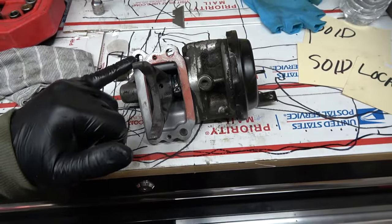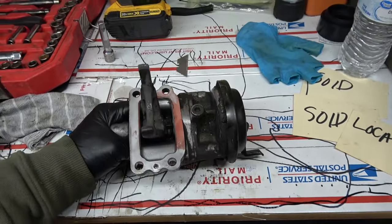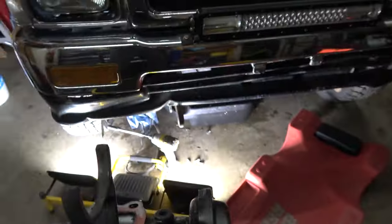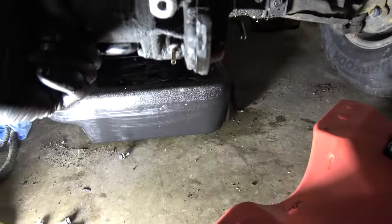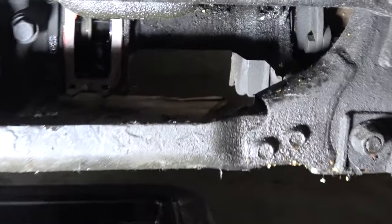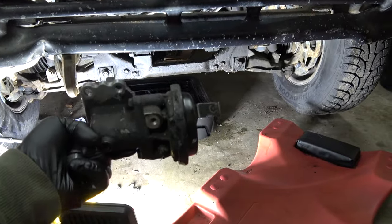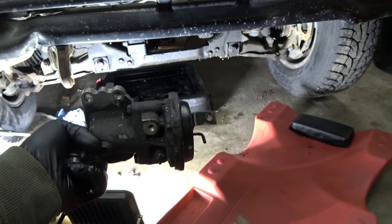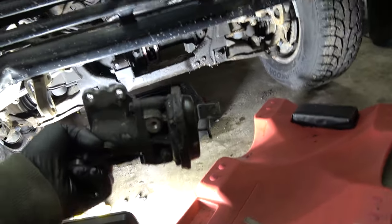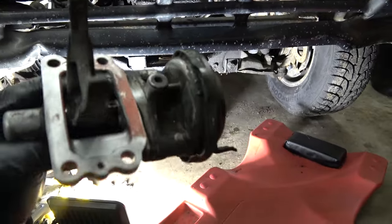Make sure you shift the fork into the four-wheel drive position towards the passenger side, then put something in between. Just put the zip tie right between it — as long as this cannot shift back into the two-wheel drive position, you're good. All you've got to do now is clean it up, put some black RTV, install the four bolts, and go from there. Before you apply RTV, try installing the actuator first to learn which way it goes in so you don't smear RTV on your first attempt.